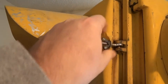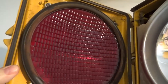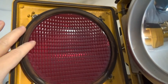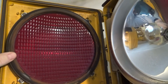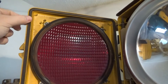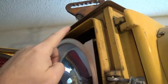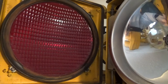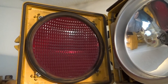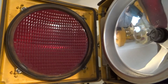Inside the light — which was typical of the time — you had the door that would open. You have the lens and the rubber gasket around the lens. This would create a seal against the reflector edge, and then you have the door gasket itself around the outer side that would seal against the edges of the light. It was pretty reliable at the time. Over years though — 30, 40, 50 years — eventually these seals would wear and rot and you'd get moisture in the light.